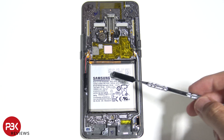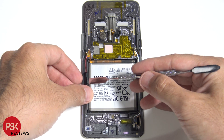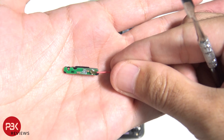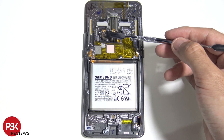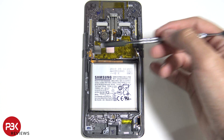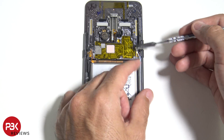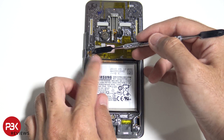As far as the battery goes, there's some adhesive underneath it holding it down. I'm not going to attempt to remove it because when it comes to Samsung and batteries I pretty much want to stay away from that — there's nothing really hiding underneath it. You've got this plastic tab which underneath has some sort of antenna connection, and a square thermal pad that sits underneath the board. You have your vibrator motor, your volume keys, and your power button. The clickers underneath are sitting on this black tab — you could pull those off. These gold contacts make a connection with the board, same for the power button.